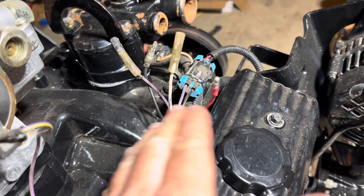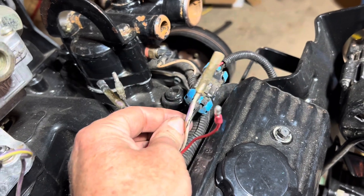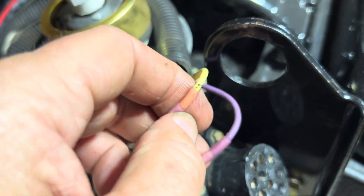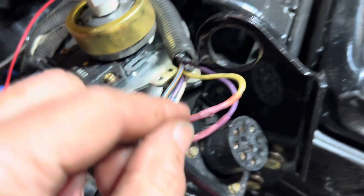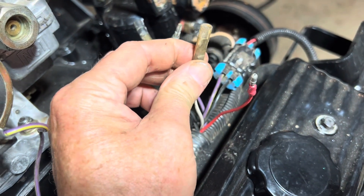This new way does not need you to tie into the fuel pump positive. I used to tie into this purple wire here — I don't need to do that anymore. This purple wire was feeding the module with power, but the module no longer needs to be powered there. So this purple wire is now free. I tied it to the white with black stripe, which comes out here. Now I've got my plus 12 volts here from my shift-kill service.